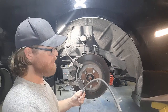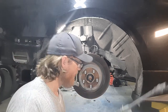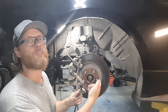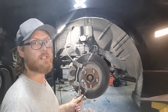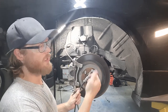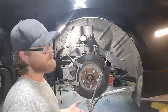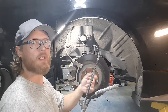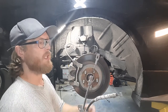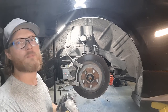There are a couple more 10mm and 13mm fasteners on the underbody of the car that ultimately lead to the other end of the cable where it goes to the distribution block, which is welded to the bottom of the trans tunnel. All these connectors have the ears that you depress — pull the cables out, get the cables out of their brackets — and just undo these on both sides. Then undo the e-brake with three fasteners inside the car and the whole thing just comes out the top once you disconnect all those cables.